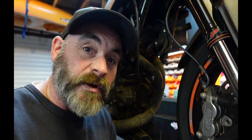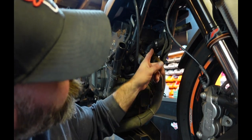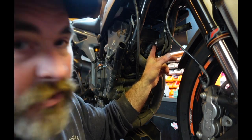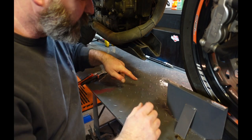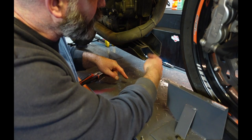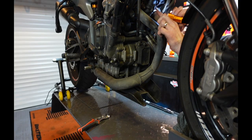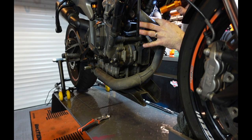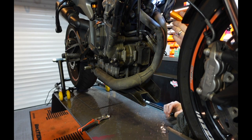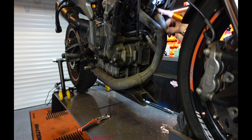Well, I didn't want to have to take the whole thing off, but it's no real hardship. At least it means I can have a proper look underneath, just to see if where I think the leak's coming from is where it's actually coming from, which is from the end of this pipe. I'm going to see if I can see any evidence of where it might have dripped. I can see it's been landing here because there's a splash mark, and directly above that it's a bit moist, which is underneath where that hose is.